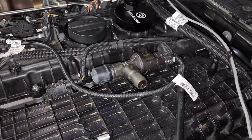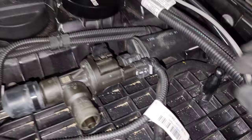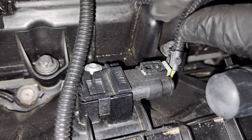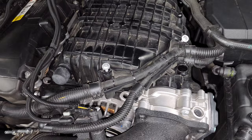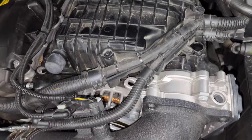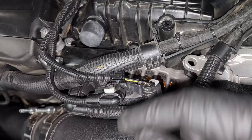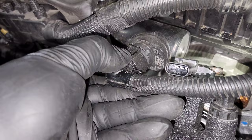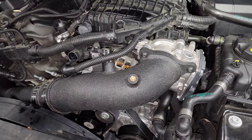There's normally another hose that connects to the front of the car at the intake manifold, disconnecting the same way, but it's been deleted on my car. Next, disconnect a couple sensors - pop the tab, push it in and slide it off - and also disconnect the MAP sensor. Towards the front of the manifold there are two T20 screws to unscrew, which lets you pick up the wiring harness and move it out of the way. There are also two more sensors on the charge pipe - pop the tab and pull them out - and one more on the motor where you squeeze the top and bottom to pull it out.